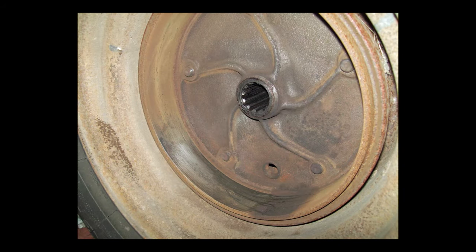You can see that the right rear brake wasn't working at all — you can see how rusty the drum is and where I sanded it clean in one part. At first I thought the reason was that the wheel cylinder pistons on the right rear were frozen and corroded solid. But I later found out that fluid would not pass through that side and would not come out the bleeder screw. From experience, I knew it was going to be the flex hose on the right side near the transaxle. In my 65 years of working on cars — I'm factory trained on GM and Ford — I've run into this flex hose problem several times. A flex hose can come apart on the inside and act like a check valve, keeping fluid from going through it, but it can also work the other way and keep fluid in the wheel cylinder, keeping the brake on.